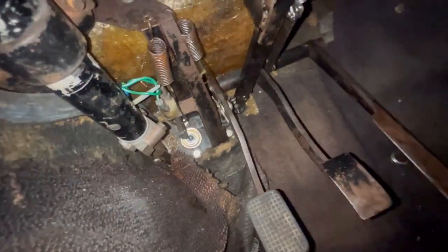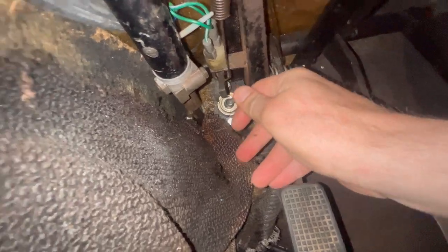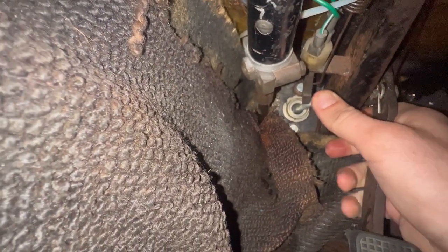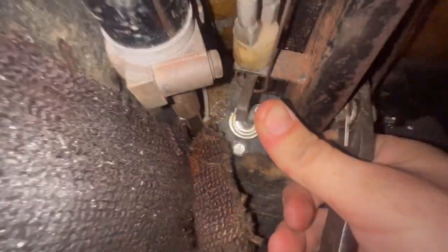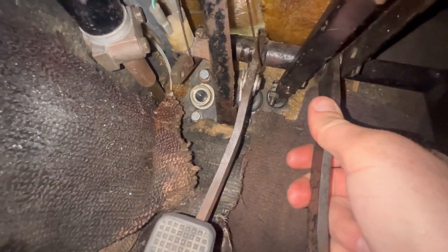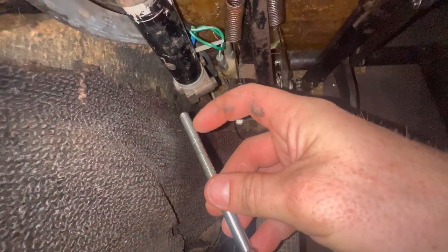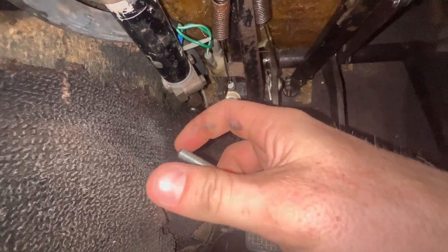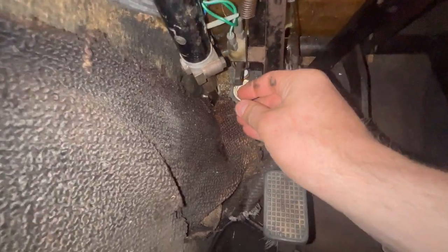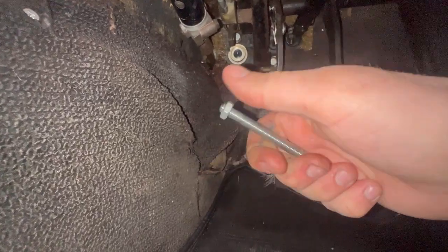So I can take that out with the AP rod and basically set it so that it's about there. You know what I mean. So when the pedal is at its high point, it's just above engaging the brakes. So what I've done is I've bought a 5/16 clevis and pin and clip, and then I will have to figure out whereabouts that wants to be, and then this will require a little bit of trimming, and then the AP lock nuts will keep it tight where it needs to be,